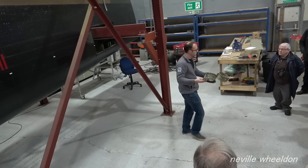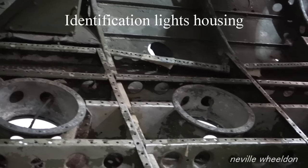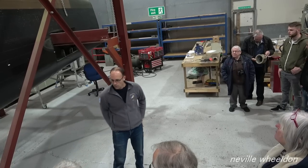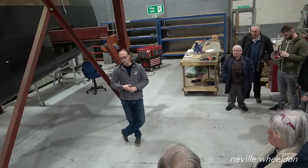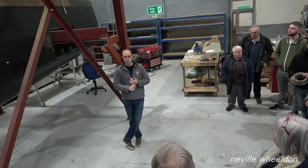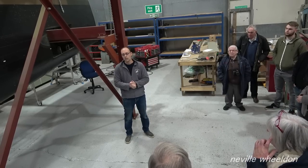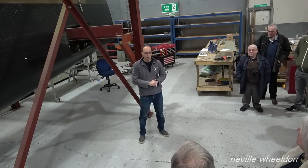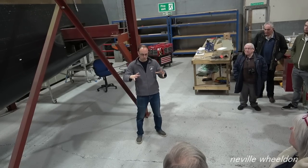A few things we've already found wrong with NX611 — there are three items that sit underneath the aircraft just up here, made out of a magnesium alloy. Because they're magnesium alloy they've started to be eaten away by the elements and are very badly corroded. Luckily we have a spare set of these, so we'll have to use the spare set. Small things like this — if you haven't done the preparation beforehand — can soon slow the project down completely. To produce new ones we'd need them drawn up, a modification raised for a change of material to aluminium, and then CNC machined. An individual item like that could probably cost us around three thousand pounds.